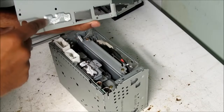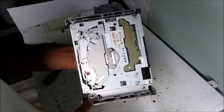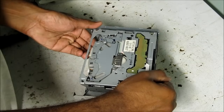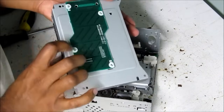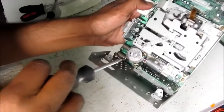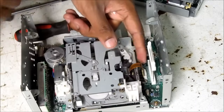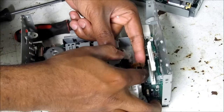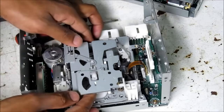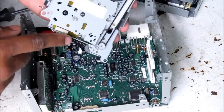There's some thermal paste there. To remove the CD player, there are four screws here that you have to remove. I'm going to pull off the top of the CD player — there is a connector underneath here. There are four more screws that need to be removed to take out the tape deck, plus this white connector on the ribbon cable that needs to be removed by pulling it up. Then we can lift out the tape deck, and there is one more connector at the bottom here.